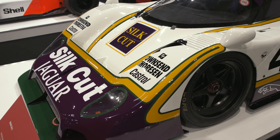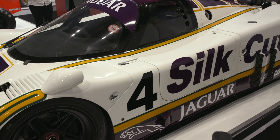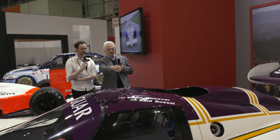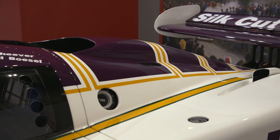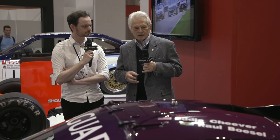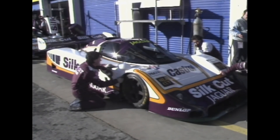That was the easiest way to generate horsepower, but it is just a single-cam two-valve engine — that's the amazing thing. But it's very big and heavy, which was a major problem for me controlling the weight distribution. All that lump dominates the car going in and out of corners, so you have to be very careful on weight distributions and centre of gravity. The engine was actually recessed right into the fuel tank, going right to the driver's shoulder, to get the weight far forward — otherwise it would dominate the car too much. It was acceptable and drivers could deal with it, and it worked.